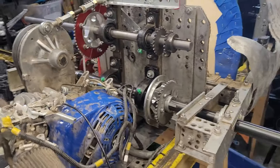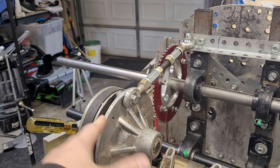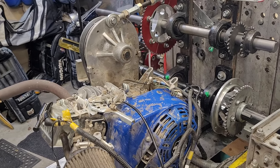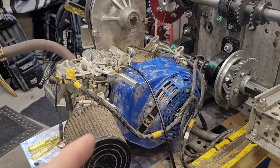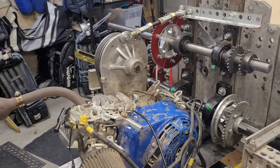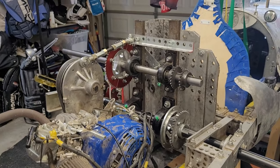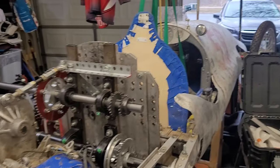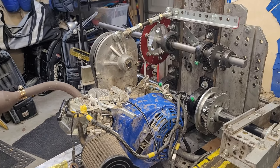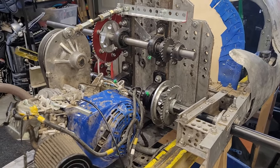The thing is, with cycle carts they have big wheels and use the torque converter — not a centrifugal clutch. So the gear reduction could stand to be a bit higher, particularly for an engine like this that's set up to rev as a go-kart racing engine. I found that when I tested it with a much higher ratio — 15-to-1 — it was great because it would start accelerating and just kept right on accelerating all the way through the rev range. I ran out of road testing it on my road. Basically, the higher gear reduction is nice because you get your engine into a really nice rev range.